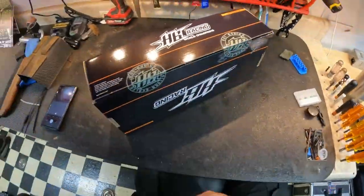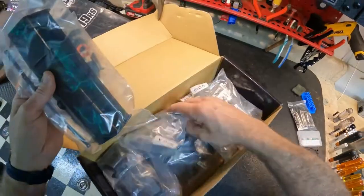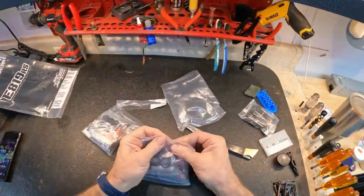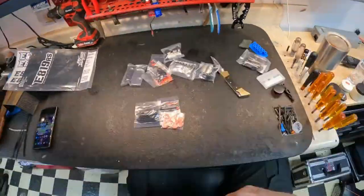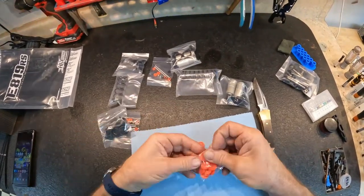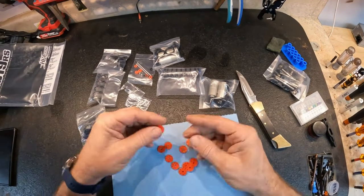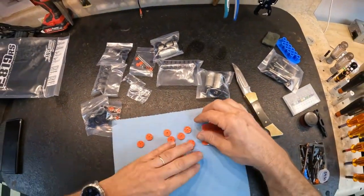Okay, so here's my first screw up using the GoPro. I had it on time lapse. Couldn't see what was going on in my head. I hadn't quite figured that out. So really, all I'm doing here is showing off my case knife that I'm using to unbox it, opening my parts, and saying that I'm digging out the 5-hole pistons to drill them out to 1.5 front and 1.6 rear. So we'll do that, and here we go.